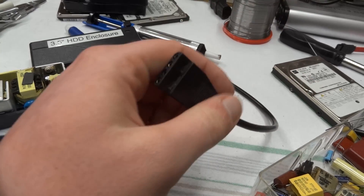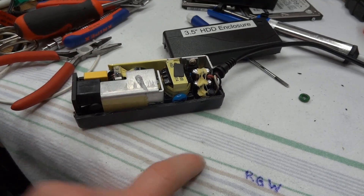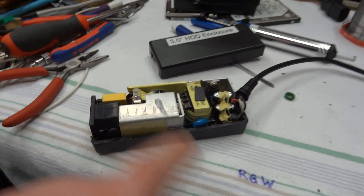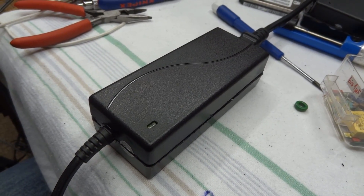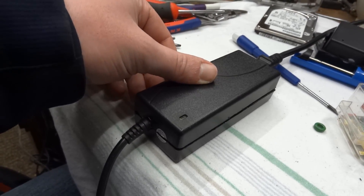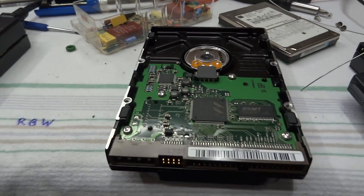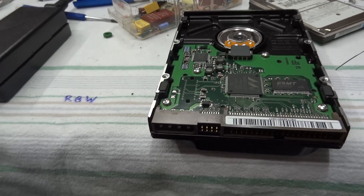It's a Molex connector — that's what they are called. I can go ahead and plug this in to see if it still works after that Dremel action and then see if this manages to power a hard disk drive. I haven't taped the housing back together yet but it does fit, and unlike our last power supply repair, this time the strain relief actually works. I went ahead and checked the voltages — they are all right, I didn't get any of them mixed up — so now comes the moment of truth.